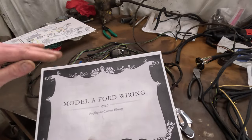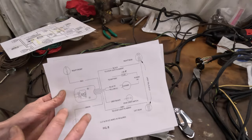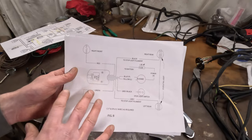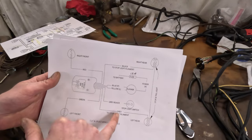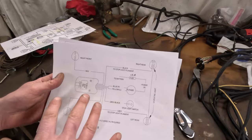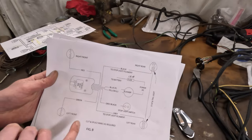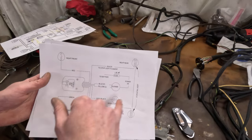If you're doing turn signals, depending on what you're using for a setup — I'm using a Signal Stat 900 — you can just Google and come up with the wiring diagram. I'll put a link to this in the description. It gives you the wire colors, the different leads, where everything has to go. I was going to try to match all these colors up to make wiring a little bit easier. I'll just make note of any differences and kind of make my own wiring diagram so if I have to troubleshoot, I know what wire goes to what.